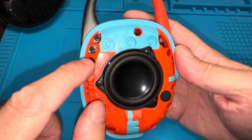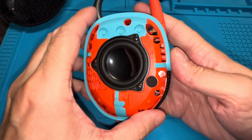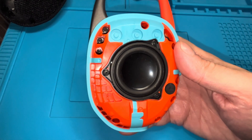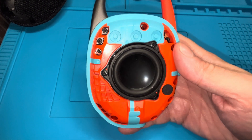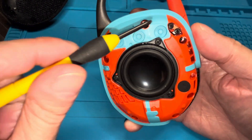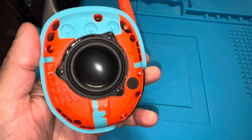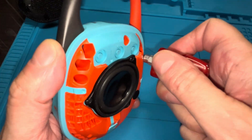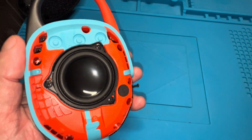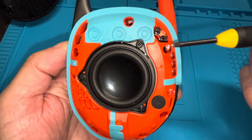Then we're going to see a whole bunch of screws, and we actually have to remove only six of those. Those six are holding on the back side of the speaker, which is also the cover to get access to the internals. There are four screws we don't remove — those are the ones for the clip part. We also leave in the three that hold the driver. I'm using a small Phillips screwdriver, and these screws were surprisingly tight, so I'm using a slightly bigger screwdriver for more grip and force.